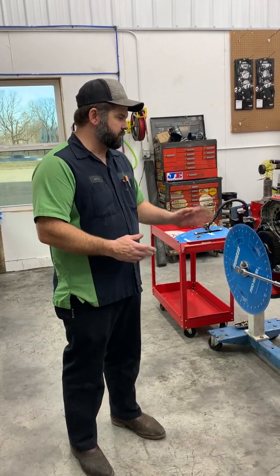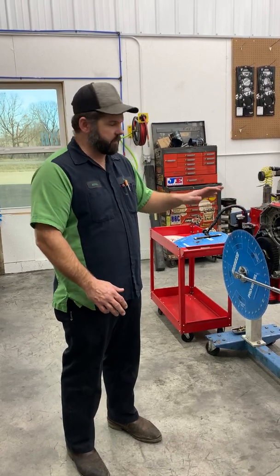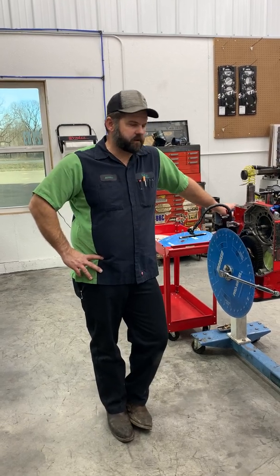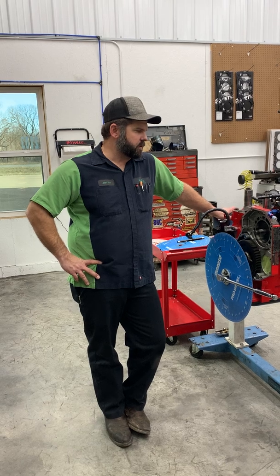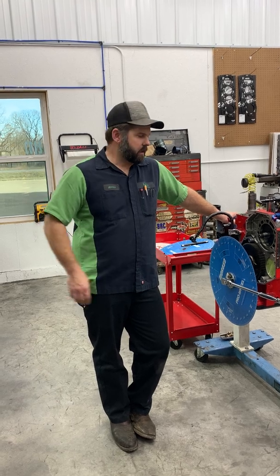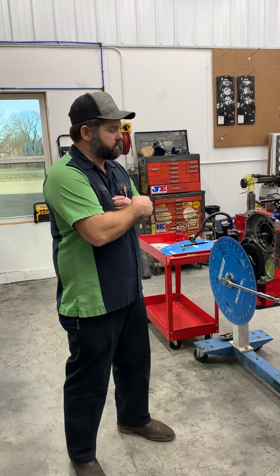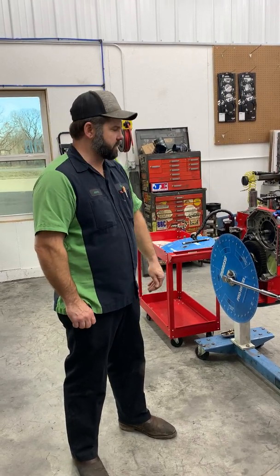First thing, we've got a 12 valve Cummins here. This is a used engine. It's not an engine we built. A customer brought this to us. We sold him parts, and he's been putting this together for a while. He wanted to make sure his combo worked, and he was trying to check valve to piston and had some issues. He didn't have the right tooling, so he brought it up here for us to do. In order to do it properly, we wanted to degree the camshaft, so we pulled the head back off, and we're kind of starting over and checking this thing right for him.